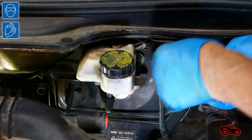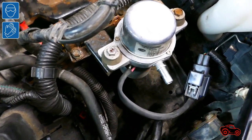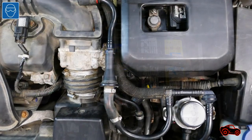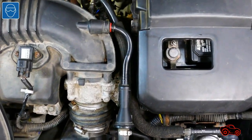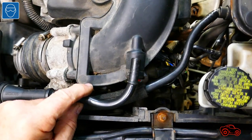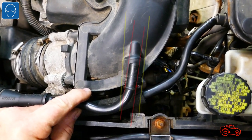Next, I reconnected the vacuum switch plug. I also installed the extra vacuum pump, the battery tray and the battery. Later, when I installed the hose and check valve assembly, I noticed something. The hose connected into the quick connect receptacle of the upper intake manifold was not fitting properly. It looked like the thermo-formed plastic hose had lost its original bending angle over the years.